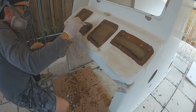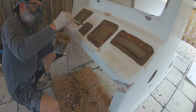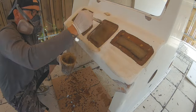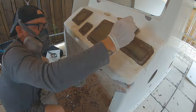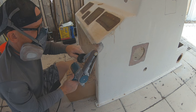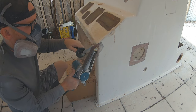After about three or four layers of 1708, I switched to a one-and-a-half ounce chop strand mat for the bigger pieces, getting bigger and bigger and then tapering it out to that area where I ground. The reason is that chop strand mat is going to make it easier to blend this repair into the existing gel coat or paint, whatever the white is on your console.